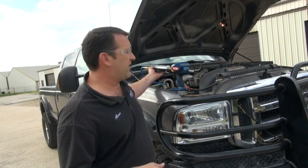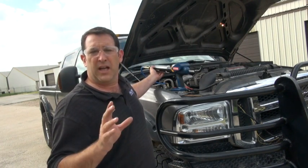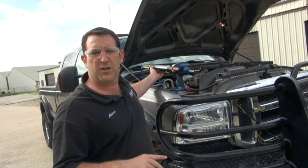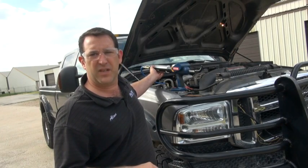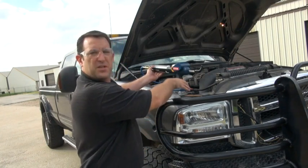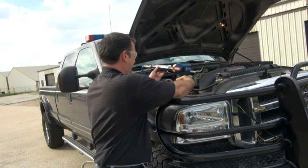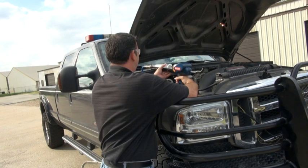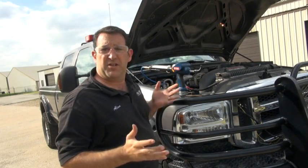And with this, I've got my hash marks already on this 8-ounce cylinder. If you've watched some of our other videos, we installed this on a 4-ton home unit. So now I have 2 ounces left in this container, and I just simply pull the trigger. I just installed my 1 ounce, and now we'll give it a few minutes to cycle through.